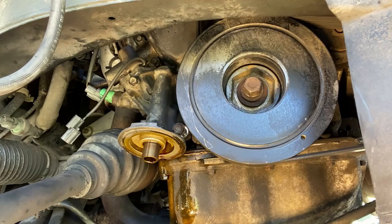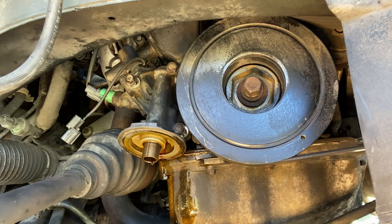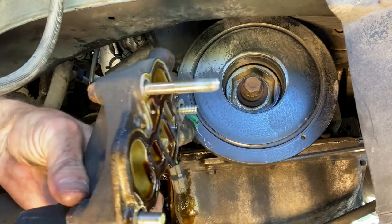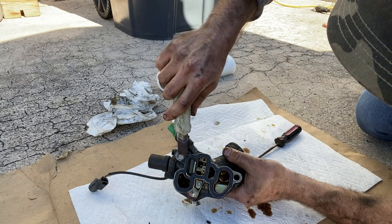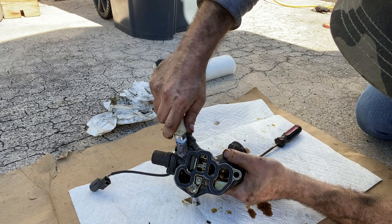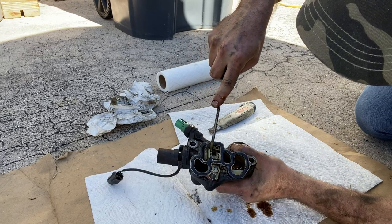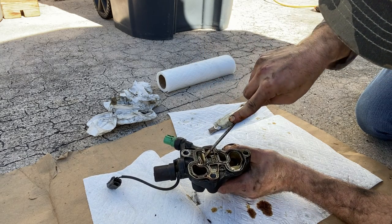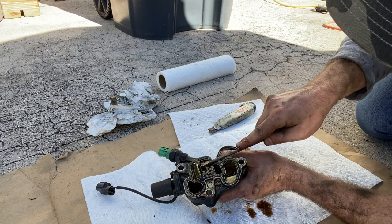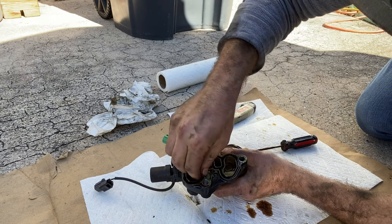Now we remove the assembly by taking off the three bolts one at a time and tugging on the assembly by hand. There will be some resistance because it's been on so long. Because the gasket is so old and brittle, it's very difficult to remove, so I try to remove it with a sharp edge and a screwdriver, taking care not to scuff or scratch the surface of the assembly. Scratching the groove could create an oil path for a future leak even with a new gasket. I approach it by removing the filter within the gasket first, then tug on the gasket material itself until it pops out.